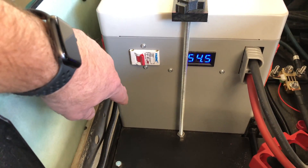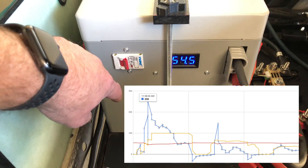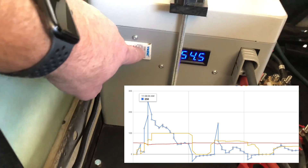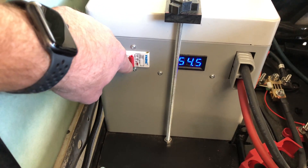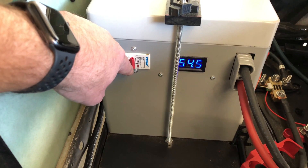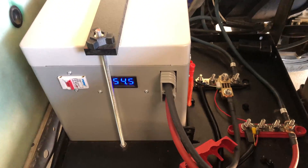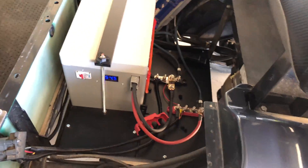There's a breaker so if you need to switch it off, or if you pull too many amps — which I never have. I can easily hit 250 amps and this thing won't trip, and that's what it's rated for: 250 amps sustained for a little bit. Right when you accelerate it peaks at 250 and then usually drops down to below 100. You can flip it off if you need to, and there's a built-in voltage readout as well.